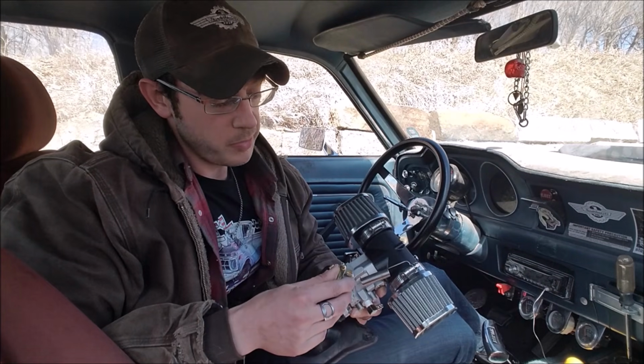You know, as you open that throttle, you're allowing more and more air in, and your cylinder pressure is increasing. And when you get into the throttle really hard, your cylinder pressure goes up, and that's why vacuum advance drops out, because we don't need that much timing to burn the mixture at the right time. So I think that methodology is going to apply to this thing.